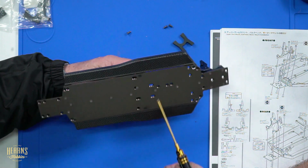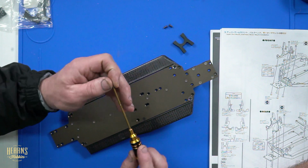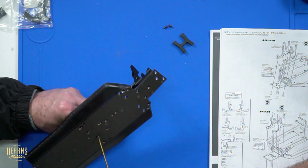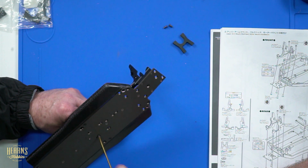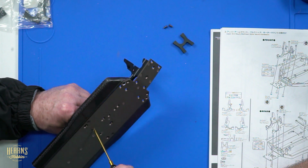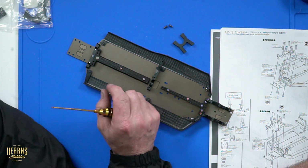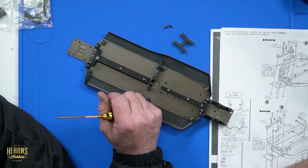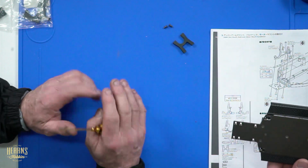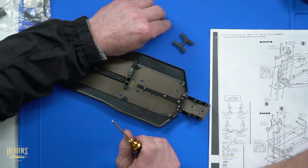No. So you can. Why would you adjust the centre diff though? I don't get it. Weight. Weight? Like, you're not reducing it. No, it's still the same weight, mate. The way the car handles. Yeah? So when I first drove one of these, with the diff forward, the car has so much steering, I couldn't drive it. With the diff forward and the pure standard kit build, right? I could not drive the car. The back end just had no capability of keeping up with the front.